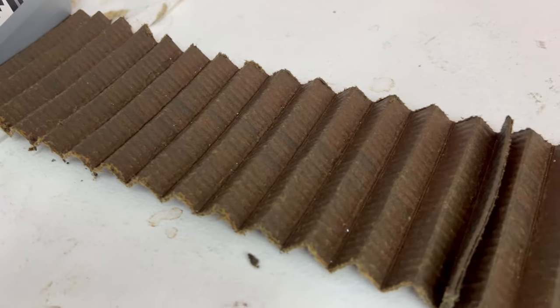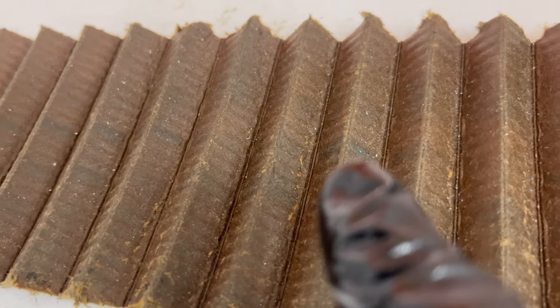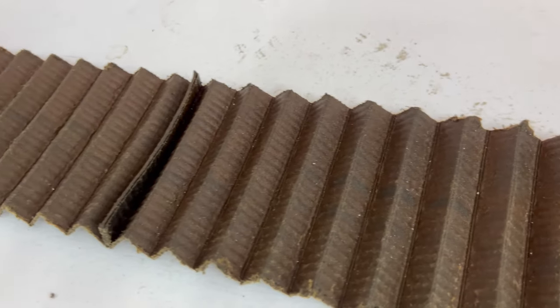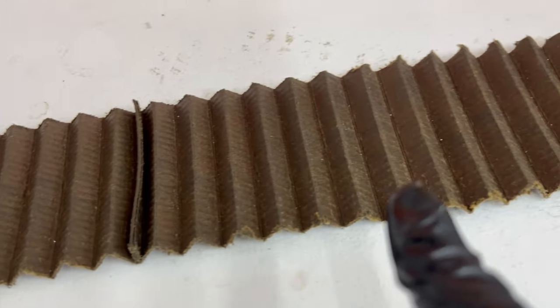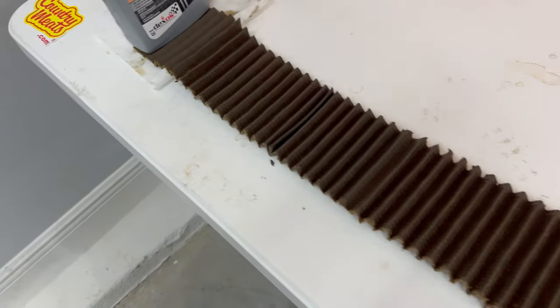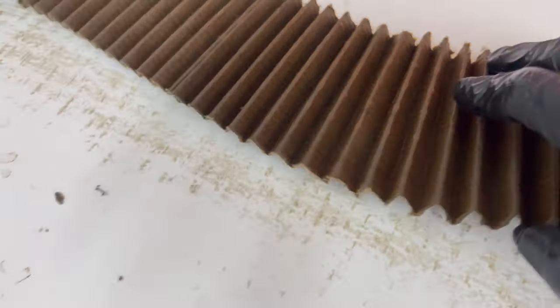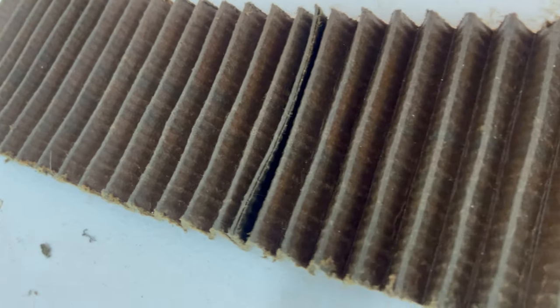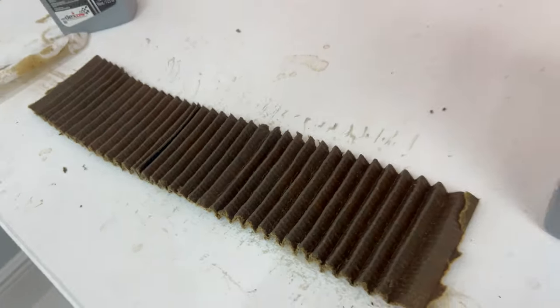So we got the oil filter all laid out here. You guys can see all the little specks in there — there's a ton of them. There's also some blue ones; not really sure what that is. I'm assuming most of this is all break-in material. And if we flip the filter over, you'll notice the backside is really clean, there's nothing in there. So it must all get filtered out on this side. I didn't tear apart the Stingray filter to compare, so I have no clue what it's supposed to look like on break-in.